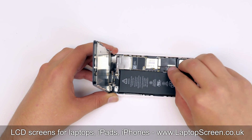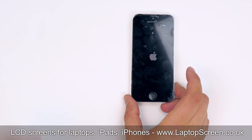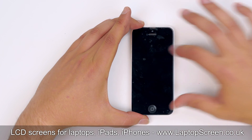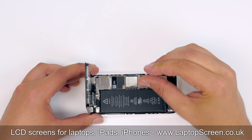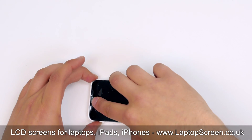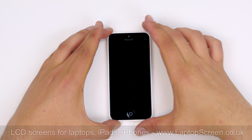Reconnect the battery. At this point we can test the device — turn the phone on, and if the startup graphics appear, the replacement part is installed correctly. Hold the power button to cancel the boot up and confirm shutdown on screen. Replace the metal shield covering the battery connector and secure it with two Phillips screws. Close the phone and slide the front assembly into the groove. Replace the two pentalobe screws at the bottom. Remove the protective film, turn the phone on, and you're done.